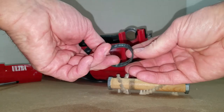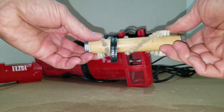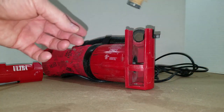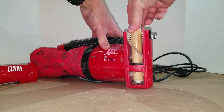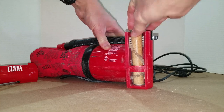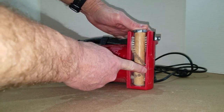Here's the new belt — it is a style one. Just slip that over the brushes. You'll already feel that it's tighter; it was a little more difficult to get over the brushes than the old one was. Slip the octagonal piece down in — there's a spot on the bottom where it goes, you'll be able to see that. Just make sure that when you put this in, you're positioning the belt so it lines up with this piece, not at the other end.